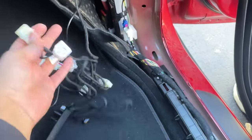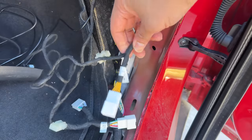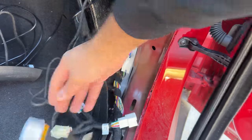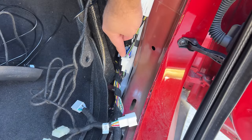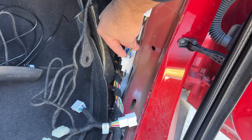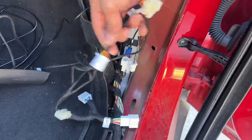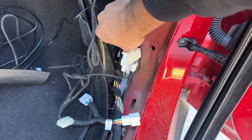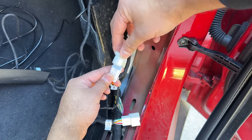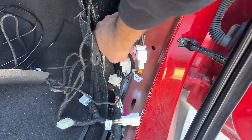Now we just need power for this connection. For the AMD car, this is your power plug — it's labeled with the AMD power source. This taps into the 12-volt power in the Tesla. Remove the existing plug by pinching on the middle and pulling it out, then take the male end of the new harness and plug it right into the 12-volt port, creating a Y connector, and plug it into the female end so it clicks into place. The power source is now done.